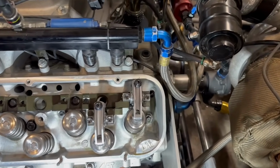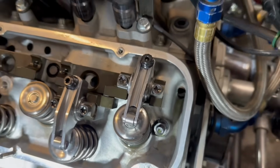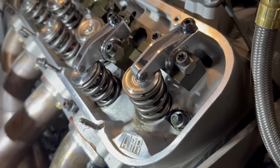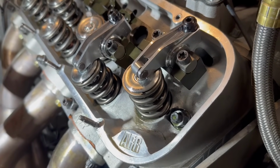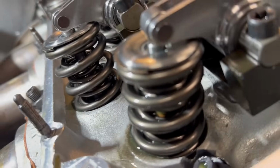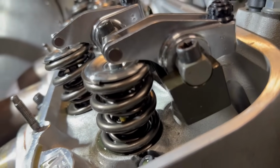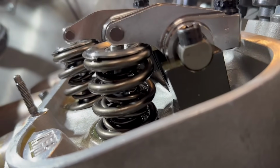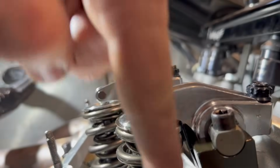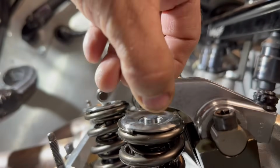And so you've got two options. The stand can go up higher. You can shim it up higher if you need to, or if you need to machine it, you can go down. What you're trying to see here is whether the rocker arm is on the intake side of the valve. That's what you want. It's going to sweep across the valve, sweep to the middle, and then go back, and then it would come up.